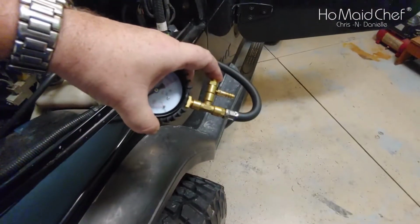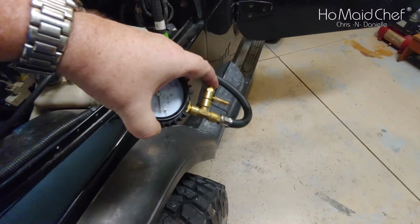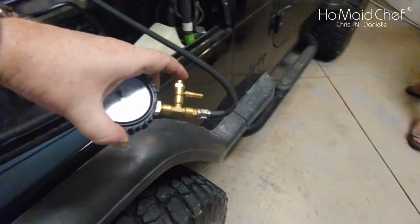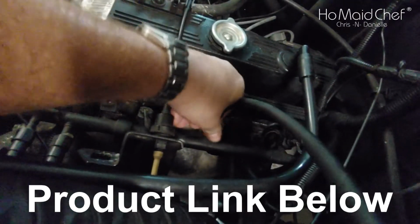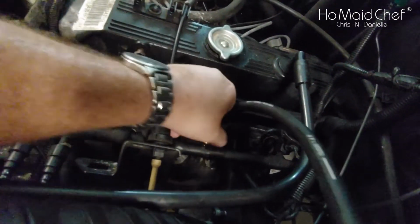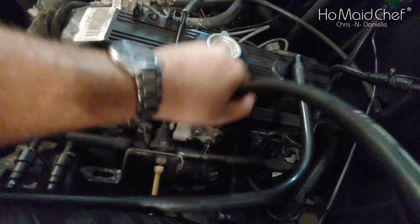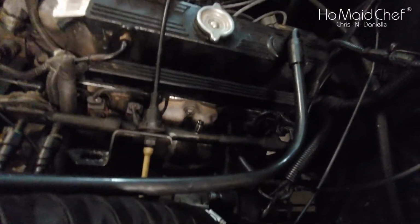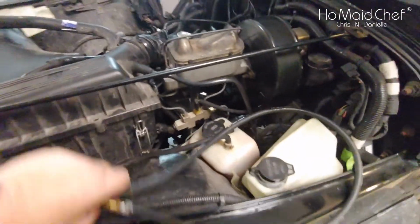So now we're going to drain off our fuel pressure. Ooh. Yeah, there. Now we got the gas smell we'll always crave. And we'll take this off right here. Be sure not to have anything running when this is coming off, because it does spew fuel. It's on the gas. Fire dead. Fire! It's smoking.